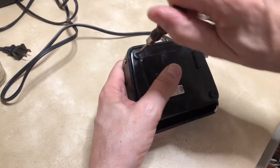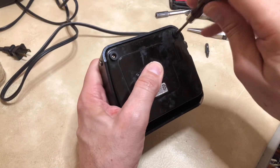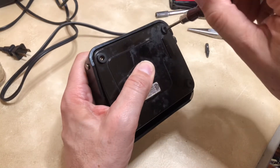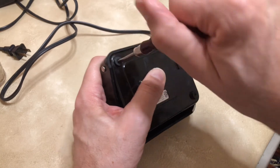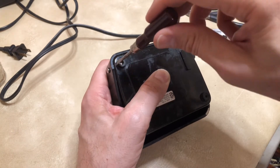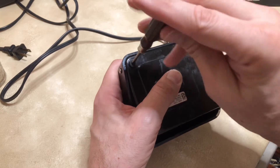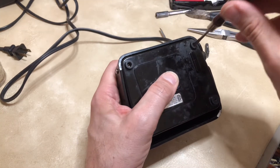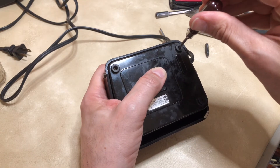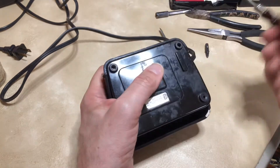If you've ever had to apply a wheel to a car, you tighten the lug nuts a little at a time, going around — I'm probably being overly retentive here, but that's the approach. As for how tight: keep going until they stop. Don't wrench them tight. It just gave — it's now snug. I stop there. As long as you get them snug, they won't go loose.